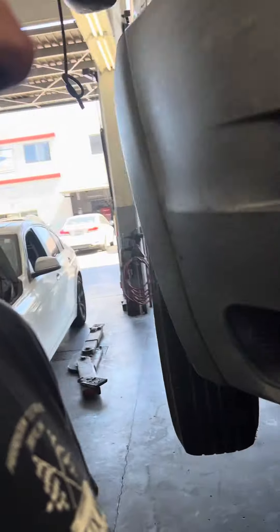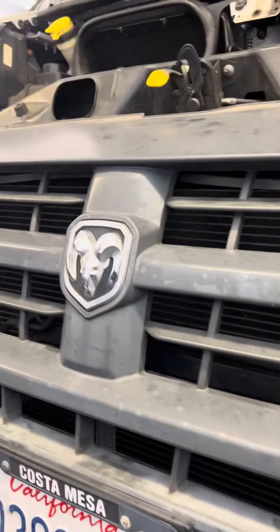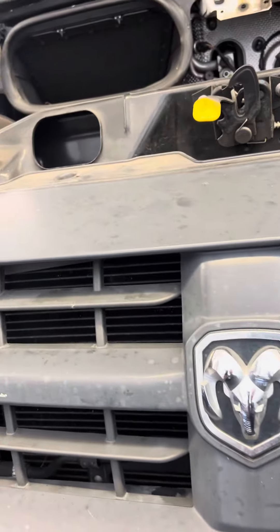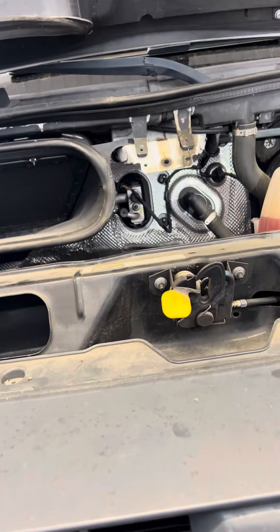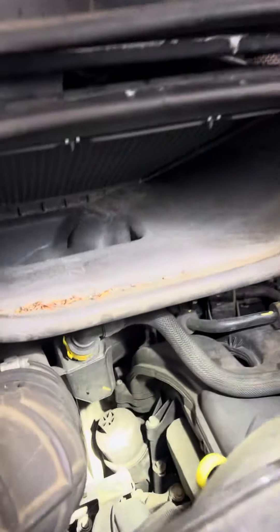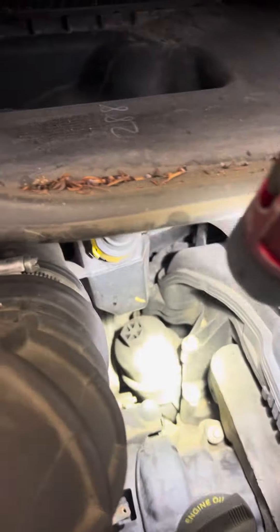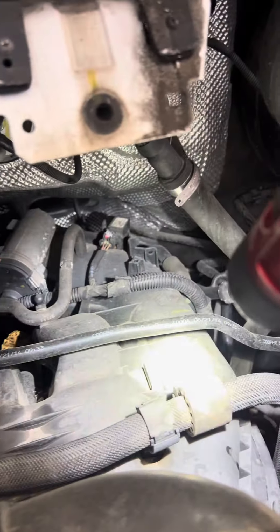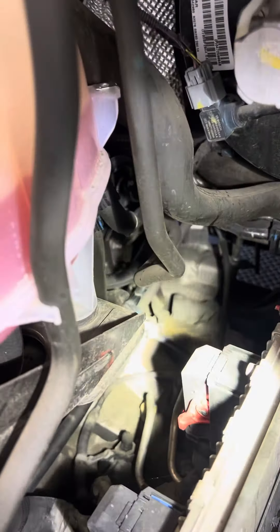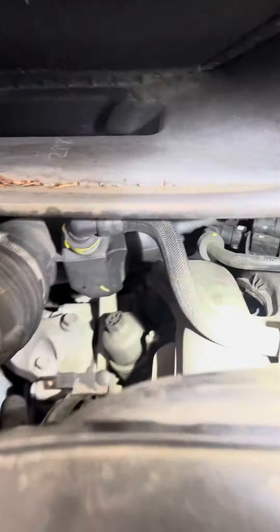Good used cases are almost impossible to find because they break so often. Under the hood: very common — oil coolers. Any 3.6 V6 engine from Mopar, almost guaranteed. The oil filter has a built-in oil cooler that goes underneath this intake plenum and tends to dump out on the transmission housing, pouring oil out the back — looking like a rear main seal when it's actually the faulty oil cooler.